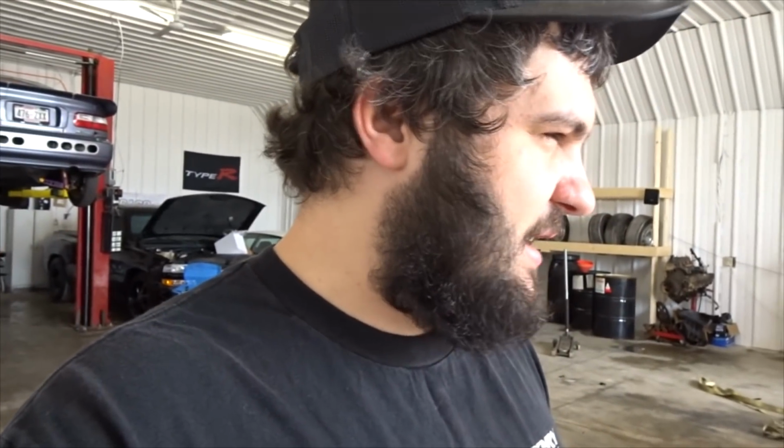The car was correcting about 26%, and it laid down 501 horsepower, like nothing. So I actually came out here today and I springed up the wastegate. Before, this car was on about a 10-pound wastegate spring, and I put a 15-pound spring in it, hoping to make 15 to 20 pounds of boost on gate pressure, and then use the boost control to give it more than that. Because I feel like with the lighter spring in here, the back pressure around 20 to 23 pounds wouldn't really allow me to go much more in boost. So that's kind of why I wanted to spring the wastegate on the car.